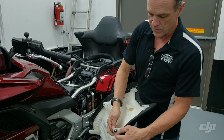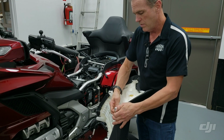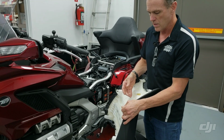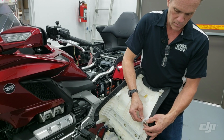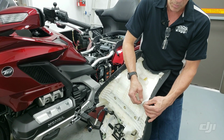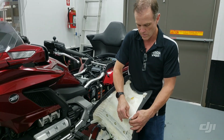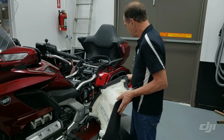See, it's designed to fit very snugly into the hole and take the place of the Honda collar. But we've had a customer or two already say, hey, I can't even get it to start threading. The problem is, because the hole has been crushed, the collar won't actually pass into the saddle like that. So if you have that, you just need to pass a drill bit through the hole to open it so that it's back to its normal state that Honda delivered it in.